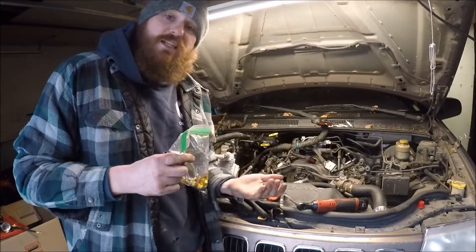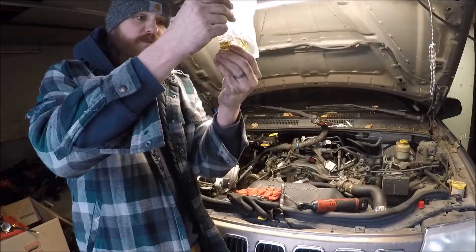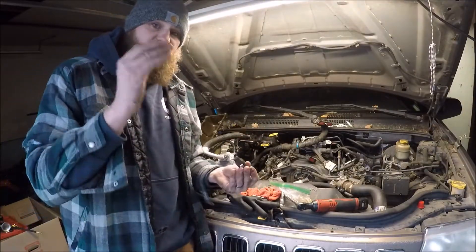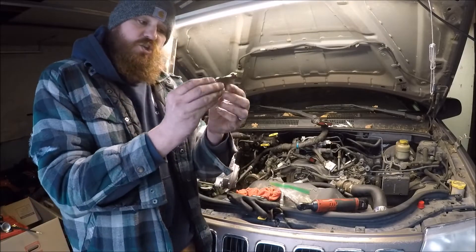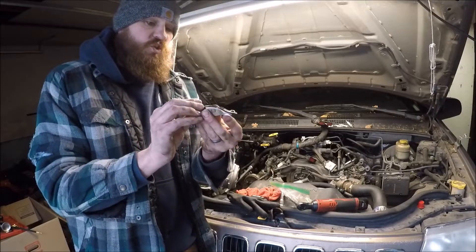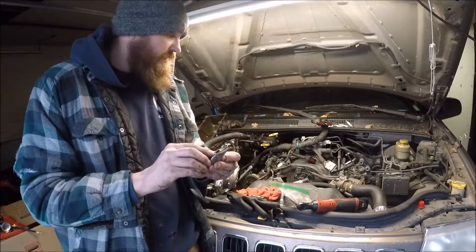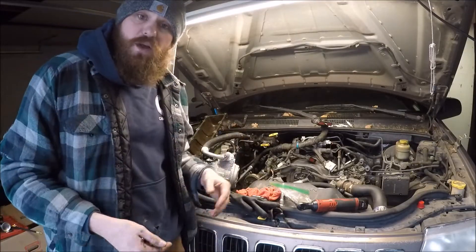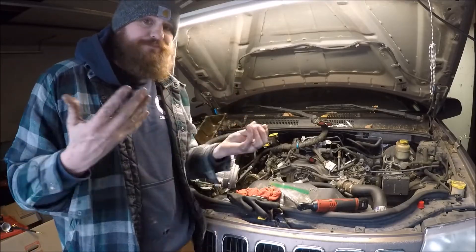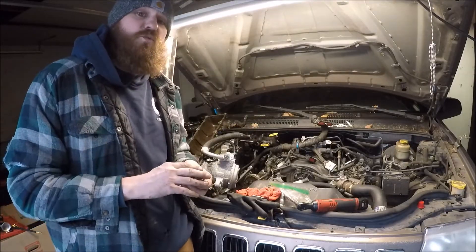So I'm going to go ahead and replace that lifter — they're pretty cheap, only about six bucks. I've been soaking it in a little Ziploc bag with oil for a while like they say you're supposed to. I'm going to pop it right back in; they just slide right in. I should be able to install the rocker arm pretty easily — you can just slide it on and pry it in with a screwdriver. There are lots of videos on YouTube showing that. I'm going to hook everything back up, change the oil, put a new valve cover gasket on, get everything back together, start this thing up and find out what happens. Fingers crossed — we diagnosed this problem and this thing should run great.